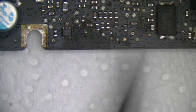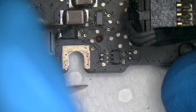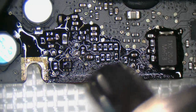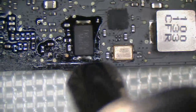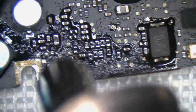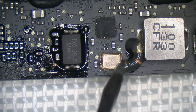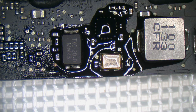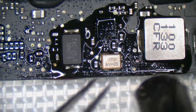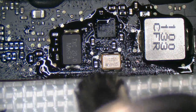We'll flux and boil this area and then work on the outside — the SMC side. There's a bit of junk up in here too that will probably get handled when it goes through the ultrasonic. You can see some fizzing going on there — that's what you want to see. It means your flux is doing its job, chewing away at that corrosion. This is the RTC clock circuit area — it needs to be kept pretty clean. On the MacBook Airs it's a notoriously bad area for giving issues, and I do get a number where they fail on this 3V3 line.